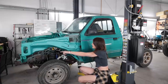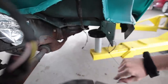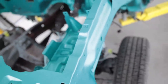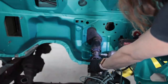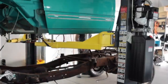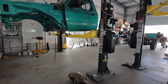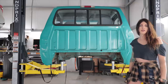I want to lift it from up there on the radiator core support, but there's no real good place to put the swing arm. Right here makes sense because that's where the cab mount is at — it's about as good of a spot as I can get. Just in case, I added some small ratchet straps underneath the cab. It doesn't seem like it's going to go anywhere — it's pretty sturdy on this lift. Yeah, this is about as sketchy as it looks, and the ratchet straps will probably do almost nothing.